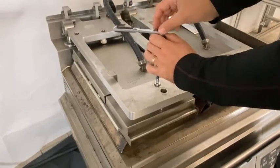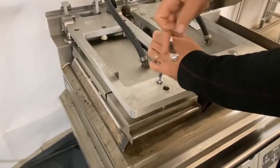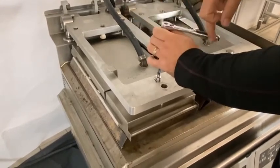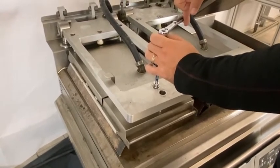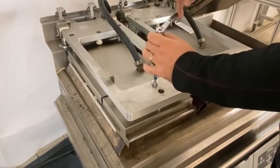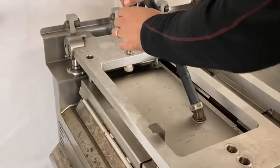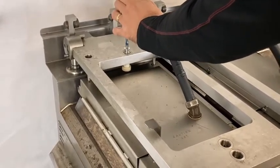Once we have the beep, we're going to go anti-clockwise until it stops. We then have to do an additional one and a quarter turns anti-clockwise. If you don't do one and a quarter turns — if you only do one turn or less — you run a risk of having a platen jam error.